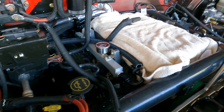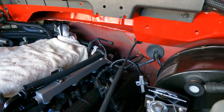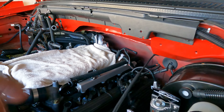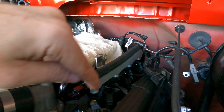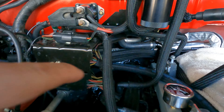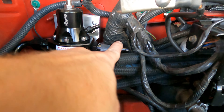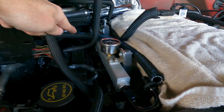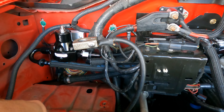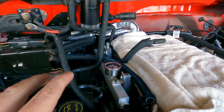We got the fuel rails in. The line that goes in the back is all hooked up and connected, as well as our feed down from the Y block — that's all bolted up and ready to go. We started running our lines coming out of the front of the rails. This 180 here — you can see the line — it's going to go all the way back behind, come in behind our coolant crossover, and run over to the regulator on a straight fitting. And from the front of this rail, we're going to 180 to the side, run behind here, loop around, and come to that 180 on the regulator. We got that pretty much mocked up, so we'll go ahead and make those lines to button up this fuel system install.